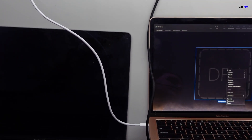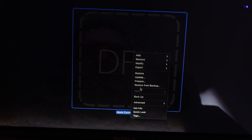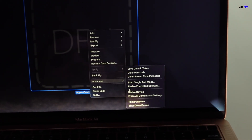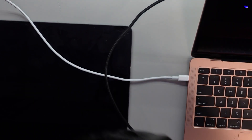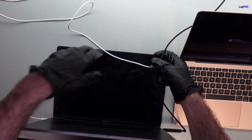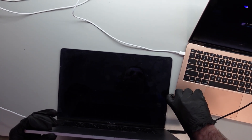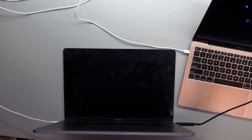This is more interesting now. So we're in DFU mode and we have options. We want to right-click it or double tap. There are two modes you can go — you can go Restore, which is the last case you want to do because it wipes all the data. So we don't want to do that. Let's go to Advanced, and let's go to Revive Device. It's going to communicate with the computer, go through the stages. If it's successful, we should get the Apple logo here. It says it's just reviving device, installing system. I'll fast forward if I have to because it's going to take a little bit of time.